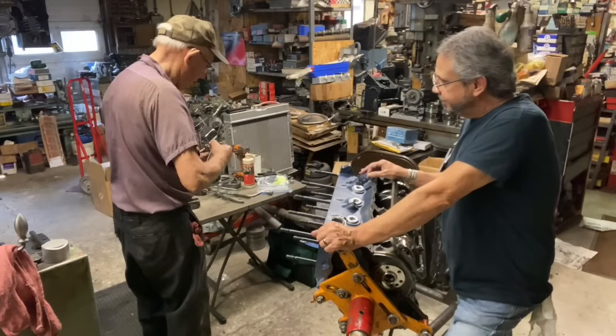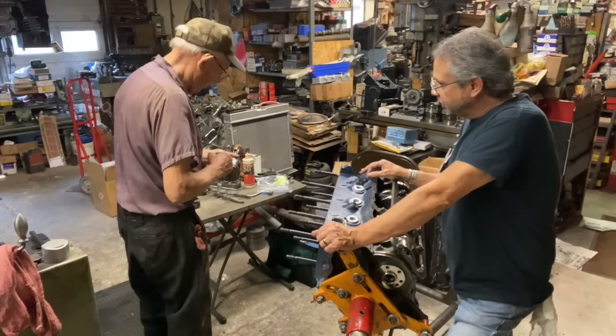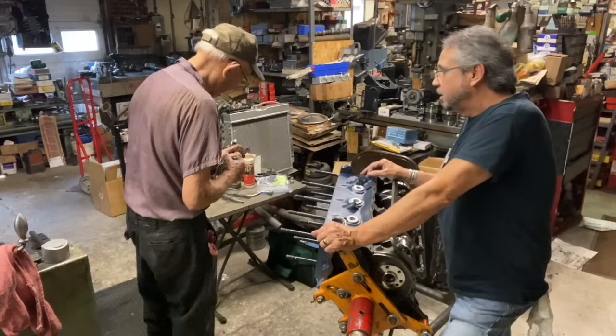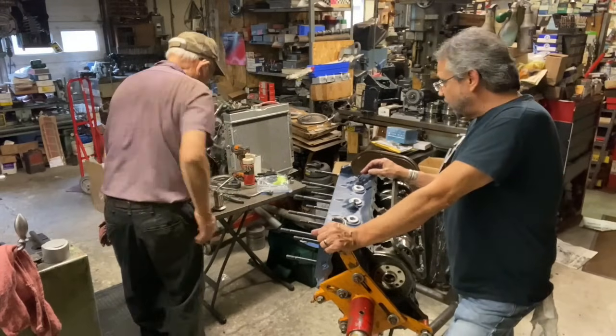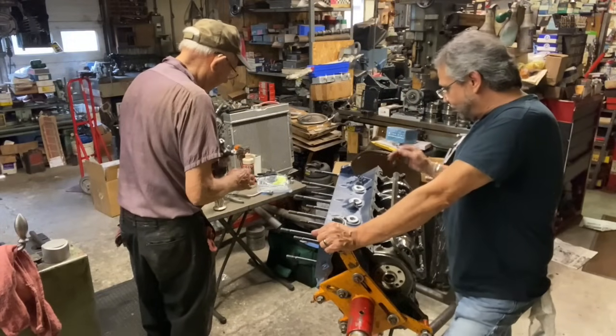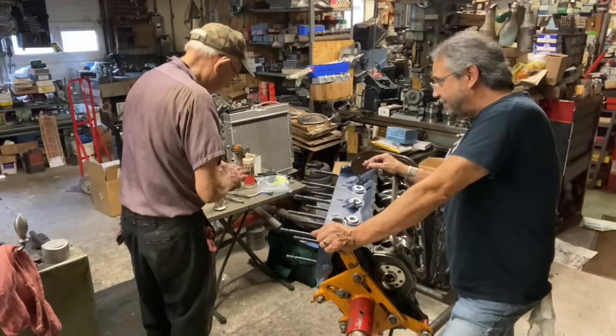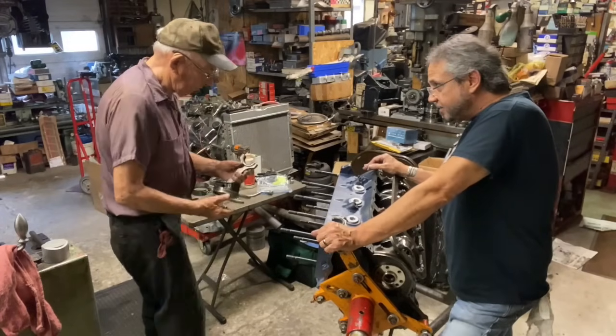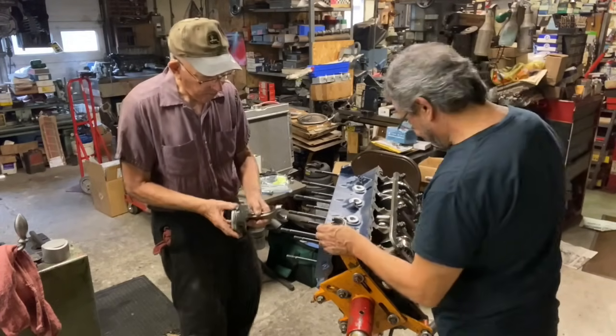RPM. But I look back at my videos, Robert, and I can see driving this car that I would have issues sometimes with oil pressure shaking when I come to a stop. And I think right before the pickup broke when it happened, yeah, could be. I think I was seeing it sucking air in. Yep. Gotta stop talking.